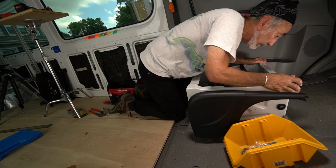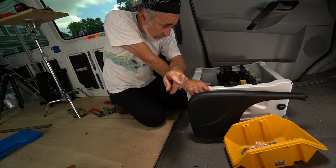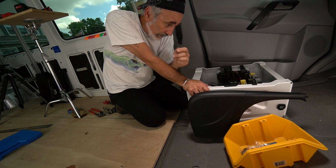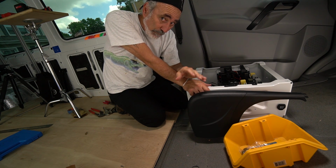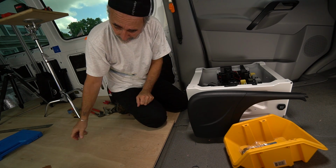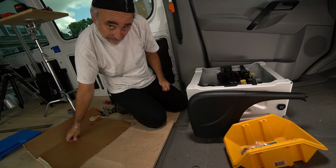I'm going to put another battery over there. I got one under the hood, which actually I'm going to have to yank. I'm going to buy 2 matching batteries. One goes under the hood, the other one goes here, and it feeds in over here. Those batteries are going to operate a separate charging system for all of your phones, your iPads, whatever you want. All the little draw stuff I'm going to set up on a different battery pack. The one that's here, the house, charges with the alternator, and I'll put a small inverter on it, like a 400 watt or 600 watt inverter, and you could do all your little stuff off of that system, and then we'll reserve the big lithiums for the cooking and the air conditioning and the whatnot.